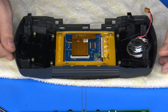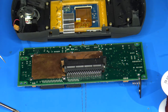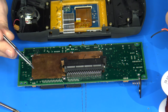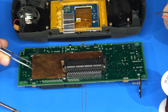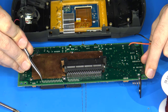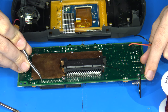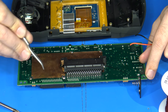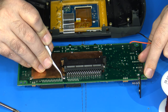So from here, what I'll need to do is get the wiring set up and start getting some wires soldered up. I think the first two wires that you should probably start with are the power and ground, just because they're not really tricky, but they kind of set the framework for where everything else needs to go in between that. So the ground wire is going to attach to the very upper leftmost pin here on the LCD connector. That's where your ground wire will go, and then your 5 volts will come from the last pin in the lower right of the ribbon cable connector.